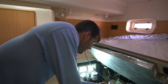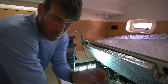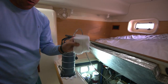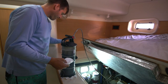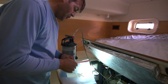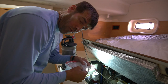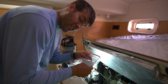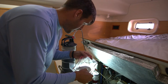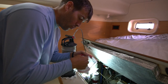Next we're going to take off the old oil filter and put on the new one, and I'm going to show you how to do that in the cleanest way possible. I want to get some of this oil sopped up, and I'm going to use a gallon Ziploc bag — put it in here, sop up some of the oil, and also unscrew the oil filter so all the oil falls into the bag. The main thing is to make sure the bag is underneath the oil filter enough, and just keep screwing it until it's off, then let it sit and drain into the bag.